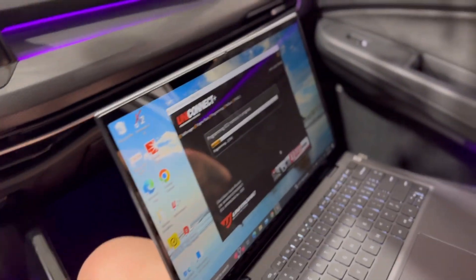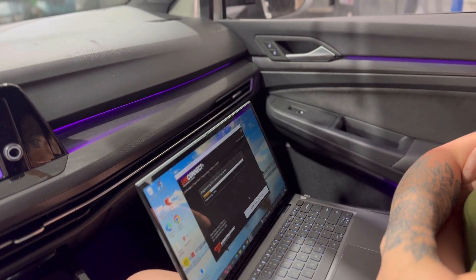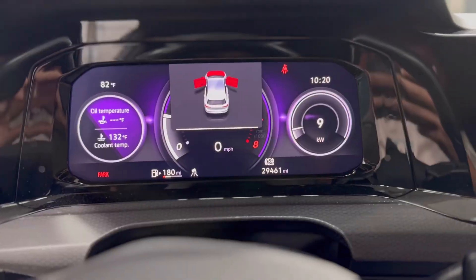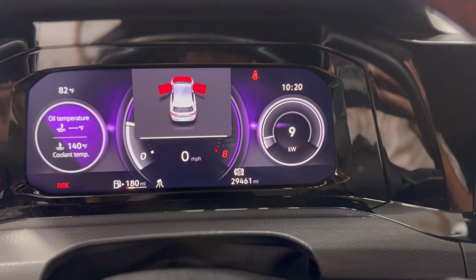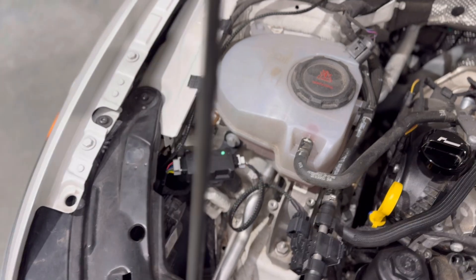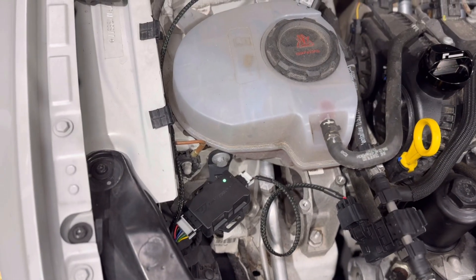We were in the middle of flashing and had to switch laptops because ours is just too old - wasn't up for the task anymore. Even though we've done it before, it just was not happy. After switching laptops, we were finally able to get it flashed. I'm going to start the car and this should give us hopefully a green light along with an ethanol reading. Right now it's saying our ethanol rating is about 9, which sounds about right because we have about 10% E added into our fuel here. And we do have a green light, which is giving us confirmation that the unit is working.